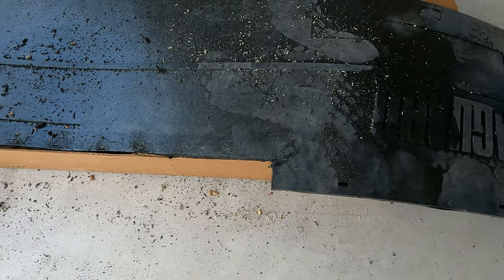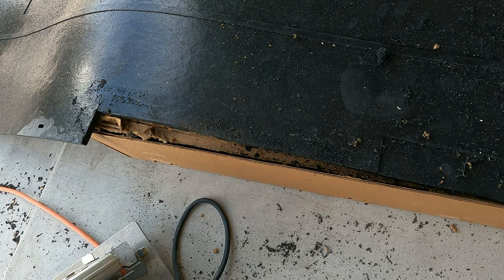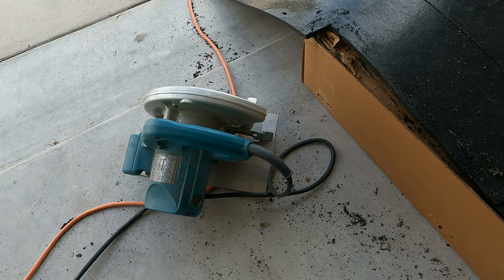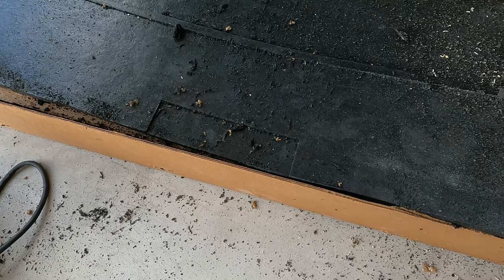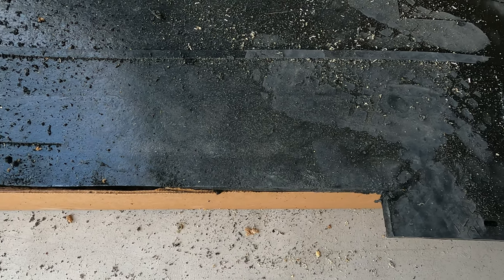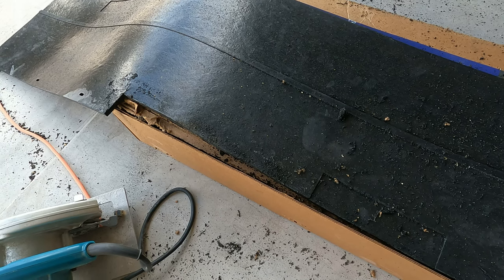I ended up having to notch the UltraGuard so that it would fit up underneath where my hitch is — I had to notch it out about two inches. It says on the instructions you can cut it with a utility knife, but that wasn't working. I ended up using my circular saw. If you do that, be really careful because once the circular saw gets in there, it wants to bite and jerk the saw back towards you. I did try it with a Dremel, which cut a little easier, but would have taken forever, so I opted for the circular saw. Now we need to put it up there, get it mounted, and start drilling some holes.